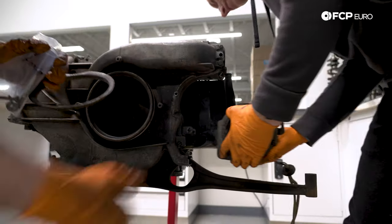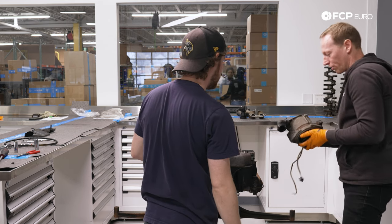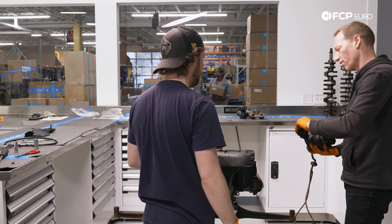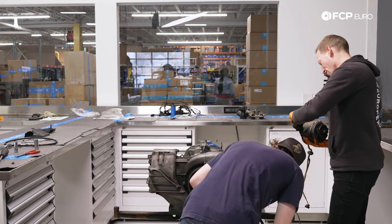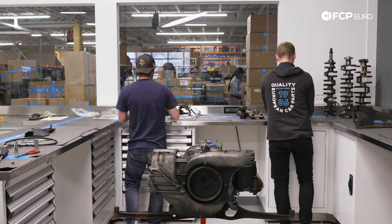There's your bracket — and there it is. That's an air-cooled alternator with a little duct on it. Basically, air does everything on this — air and oil. We use the air for the fuel ignition, we use the air for the alternator cooling, we use the air for everything.